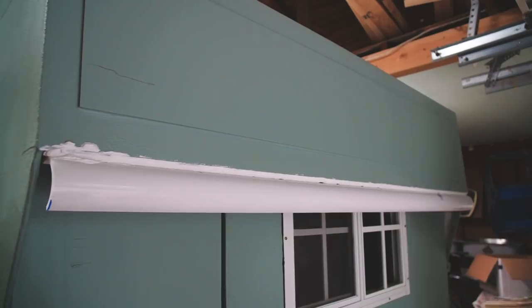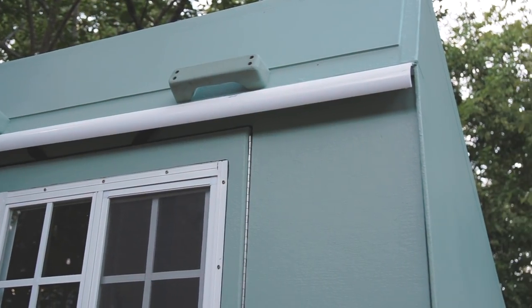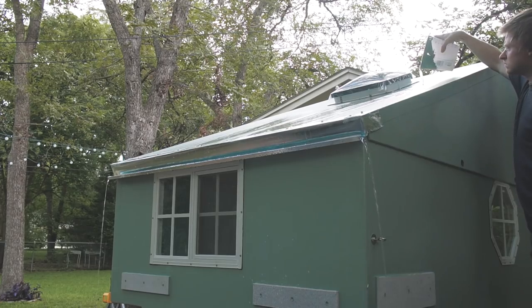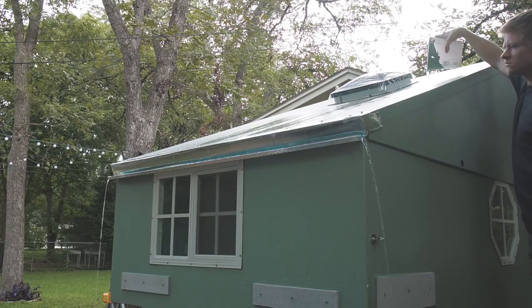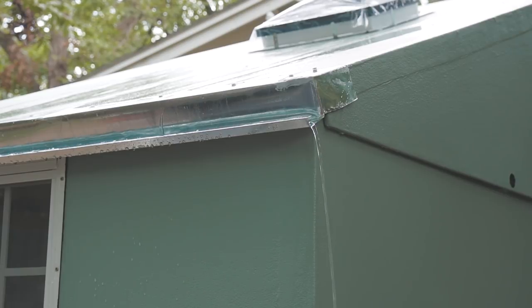Along the back edge, I added two handles and a PVC drip edge to redirect any rain water from the top edge of the door. I also added a piece of gutter-style roof flashing to the front edge to redirect any water running down the roof over to the sides. Before I had this, I tried only using rubber stripping to cover the hinge, but the water was streaming down the back wall, bombarding the window, and some was leaking in. So I sealed up any gaps I could find in the window and added the gutter. Since doing these two things, I haven't had any other leaking.